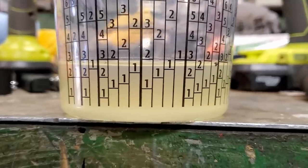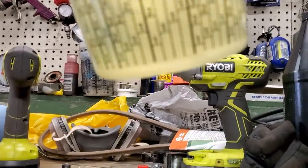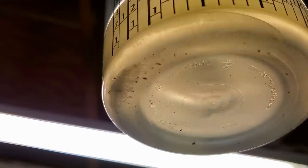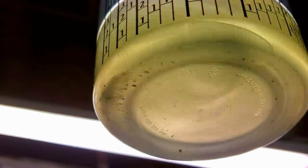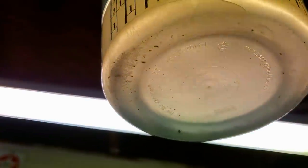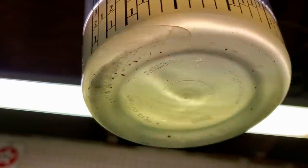Here's the gasoline that I got out of the filter. Now as you can see it does look pretty good, but it does still have a little bit of something there. I'm not sure if that's water or if that's fuel treatment - I do have some fuel treatment in there. But you see that right there? That is actually a little bit of sugar. So that means our filter is doing its job. The bad thing is that does mean there's still some in the tank, but that's not a whole lot compared to what was coming out of there before.